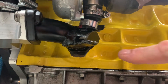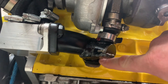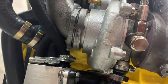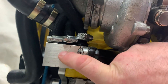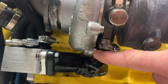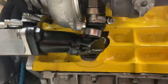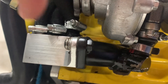What we're looking at here is the place where the original mini fuel pump would have mounted on the back of the block, and this collector here takes all the oil drains from the K-head, because as I mentioned earlier, the K-head returns its oil externally. This little collector was designed to be mounted here where the original fuel pump was, but due to the turbo hanging down, it meant that all these pipe outlets would foul the bottom of the turbo. You wouldn't be able to get the pipes on, so that was the reason why I had to make this simple elbow with two flanges on, to mount it over here out the way.